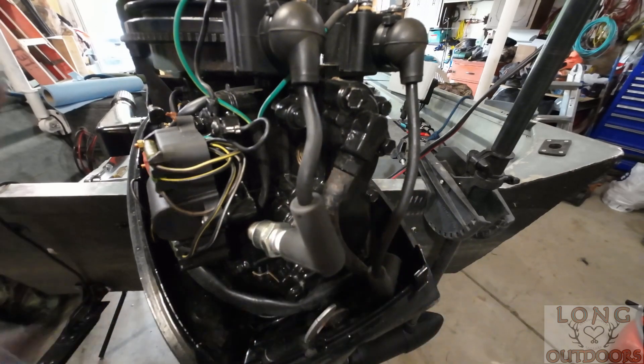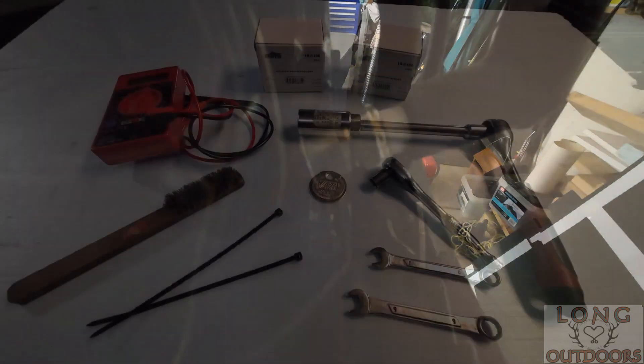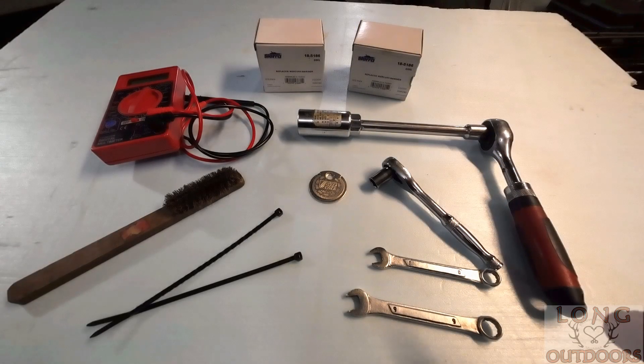I know it's dark, but it is dark for a reason. I'm touching my spark plug to that bare metal bolt and hitting my starter - you can see there is no spark jumping between the electrode and the top of the spark plug. You should see a spark, so that's one clear indication that the coils are bad.